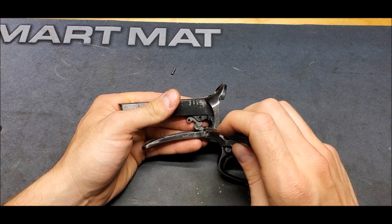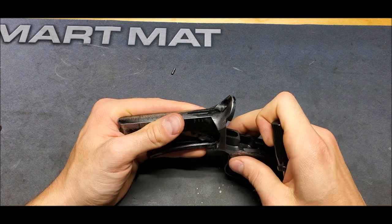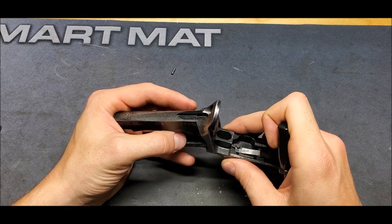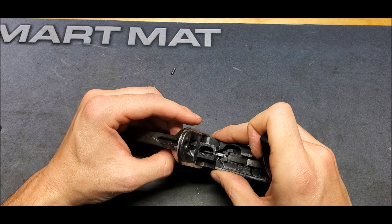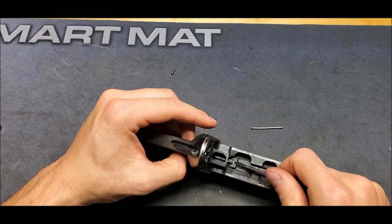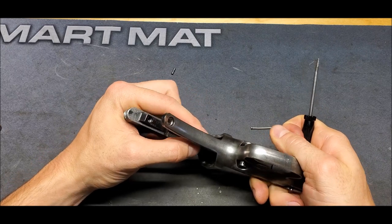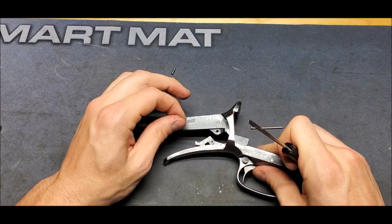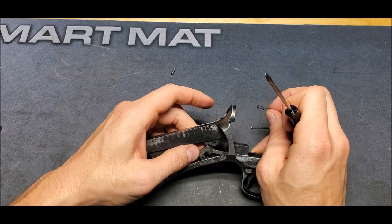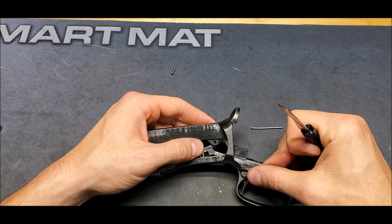while I pull my punch out, and then just kind of ease down. Okay, so the spring was on the bottom of it. It goes up into a hole on your timing rod operating lever. So now that you've got that out, this assembly, I believe, nope, that's not gonna come out just yet. But I will try and dump that spring out of there so I don't lose it. So that spring was up inside your timing rod operating lever. It was sitting up inside there like that.